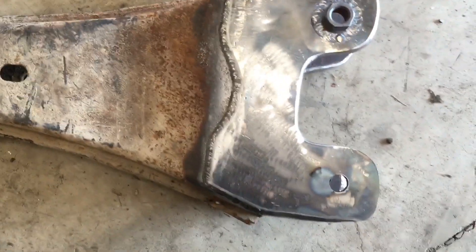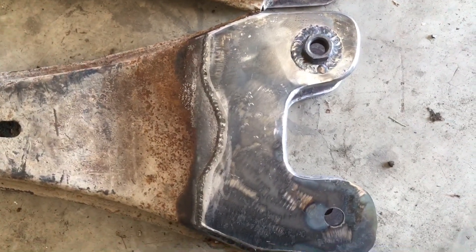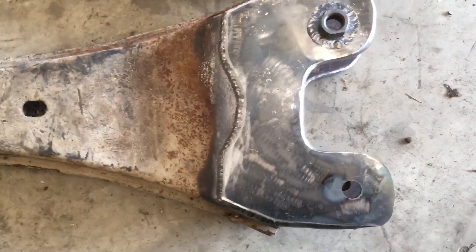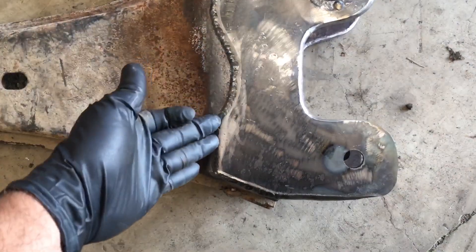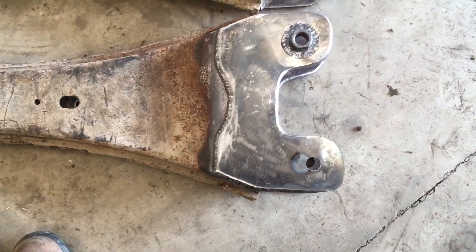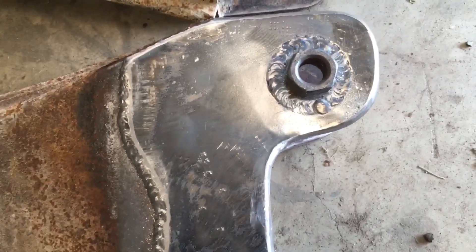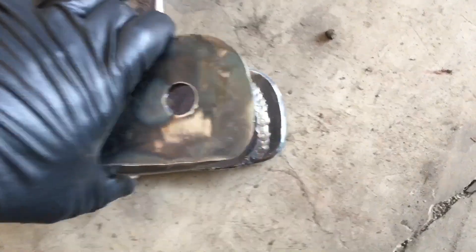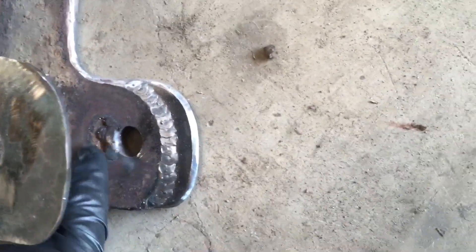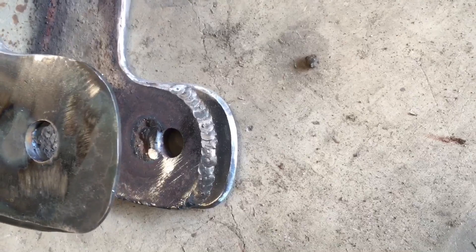Here's the completed driver's side one. I wanted to plate the entire thing to tie the strength in — kind of put a fish mouth so I don't have a perfectly straight weld. I put a little bit of a fish mouth on that for strength, welded that nut in as well, and welded around the edge the whole way around here. On the lower I extended it, welded it in just to build that strength out around that, and welded that existing hole in to strengthen things back up.